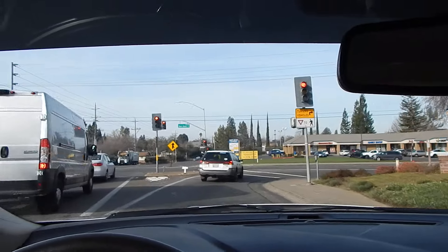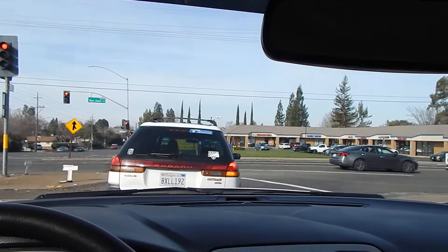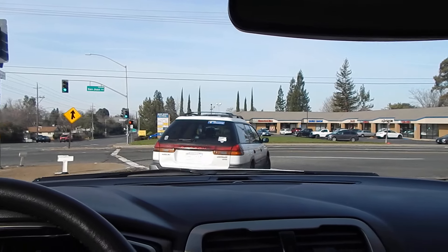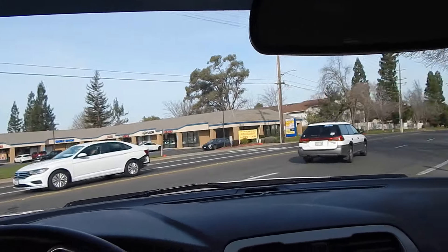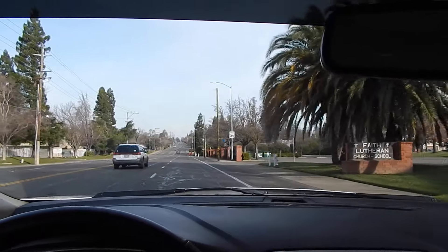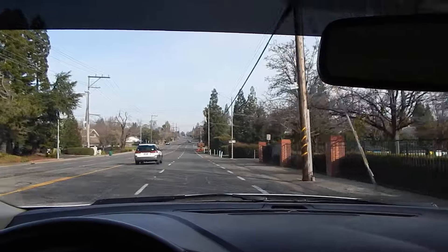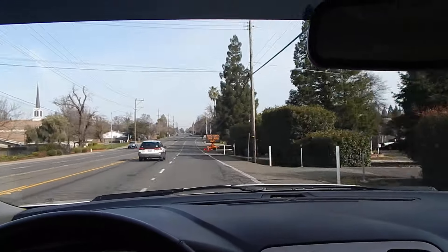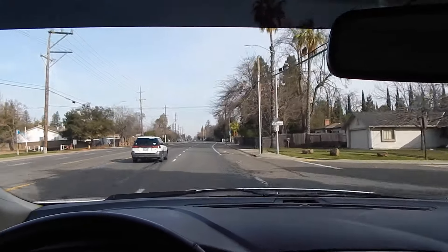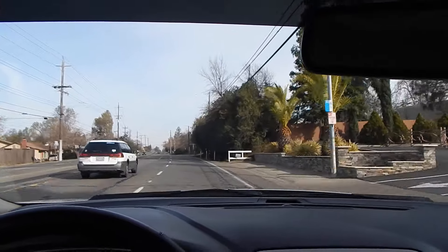This next section of road we're going to go through has really rough roads with a lot of potholes and uneven pavement, and it's going to put the suspension through its paces. If there's any looseness in the suspension — upper or lower control arms, ball joints, sway bar links, tie rod ends — if they're medium to severe, you'll typically feel the movement, the clunks, the looseness in the front end. And I'm not feeling any of that. I can feel every crack on the road and every pothole because the vehicle is very responsive, but it is not jarring by any means.